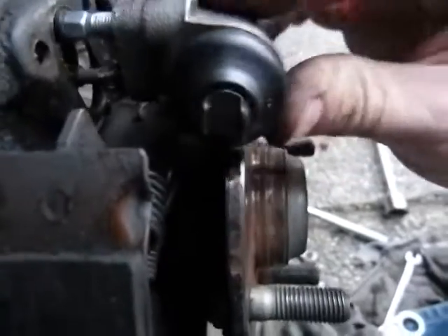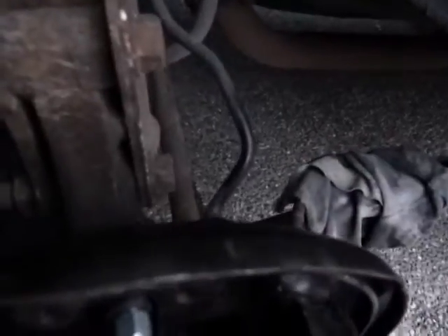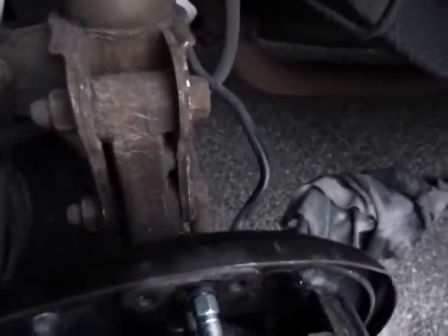Here where it belongs. If this brake line breaks for any reason, it's a problem, but not a huge problem, because it's only this short — about 10 inches long. It's a rigid metal line and it's fairly easy to replace. It's not a four-feet or one-meter-length brake line to replace, if you damage the thread or damage it beyond repair.